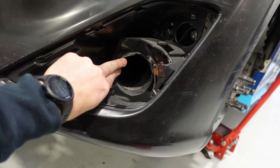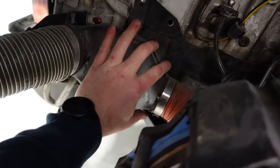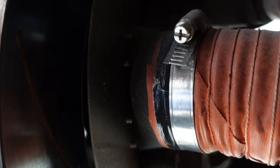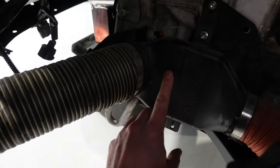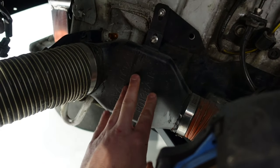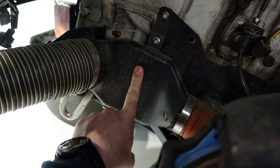Here's an example of how a brake duct system can be packaged on a car. We've got some ducting hose connecting to a vent at the front area of the car. It travels through, is bolted to the chassis, runs behind the suspension, and connects to the duct which is bolted to the back of the brake disc. As you can see, the duct has to go through quite a strange shape — it keeps a constant cross section but it does flatten in. That's because when the wheels are turned, the tyre will be in this area, so you need enough clearance for the brake duct to pass through without the tyre coming into contact with any of the duct.